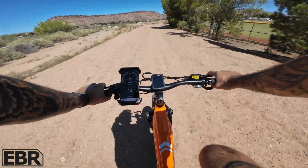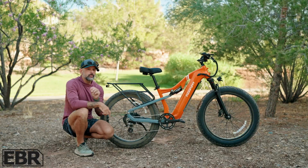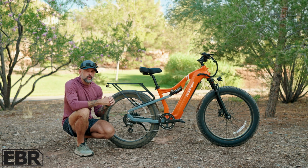It's going to be good off-road, and it does good on pavement. You'll just hear those tires on pavement. Now, the beauty of 4-inch wide tires is not only the extra grip, traction, all the things that come with them, and the ability to roll over rocks and things like that, but you can also air these down to as low as like 5 to 7 pounds, or PSI.